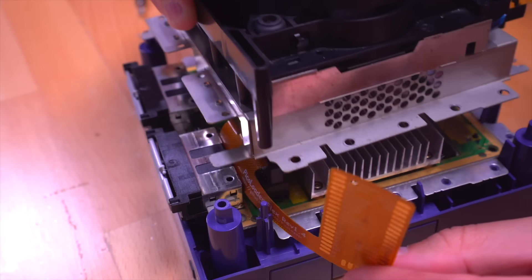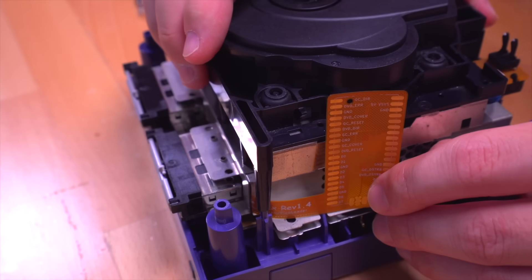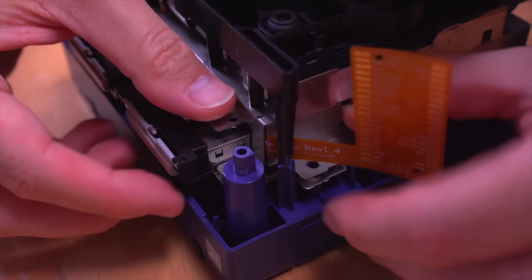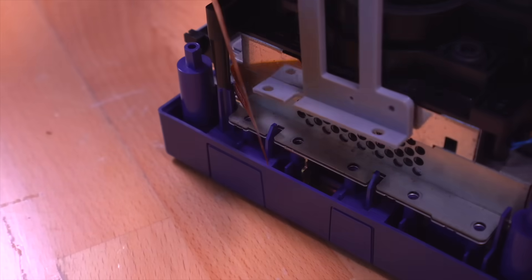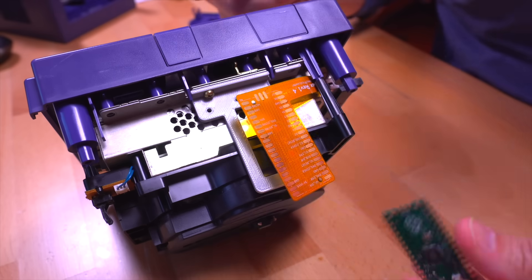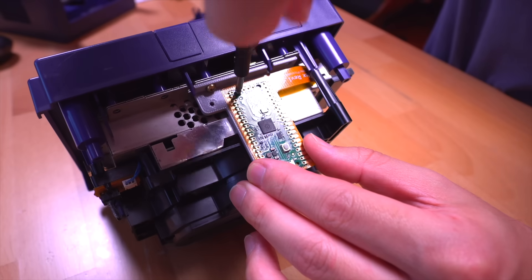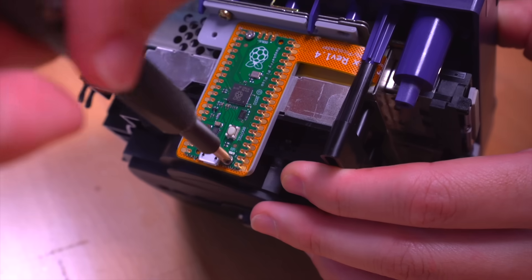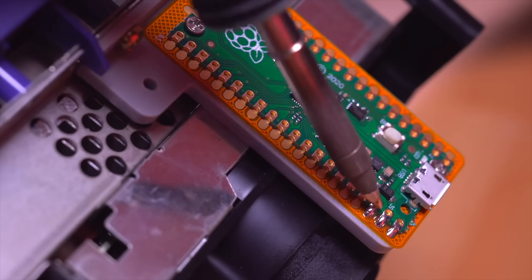Very carefully reinstall the optical drive back onto the motherboard, making sure the ribbon passes through this narrow opening in the RF shield while also keeping the ribbon on the inside of this support pillar. Once you're sure the ribbon is properly placed and not getting caught on anything, you can firmly press the optical drive into place. Next, we're going to temporarily install the 3D printed mounting bracket with a single screw. Then, we'll take the Raspberry Pi Pico and align the screw holes on the ribbon cable and the mounting bracket so we can secure it with our two M2 screws. This aligns all the pads on the ribbon cable with the Pico. Once it's fully installed, we can proceed to solder in all the pads on both sides of the Pico.